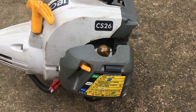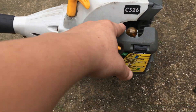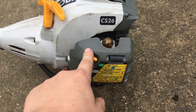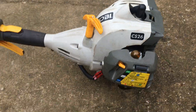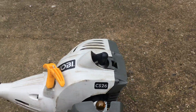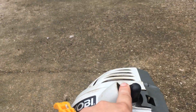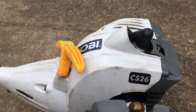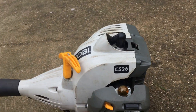Here's the problem. The carburetor — this is the carburetor right here — and that ain't the problem, because you can tell it's getting fuel, so it's not that. I cleaned it out and everything and it would not start. Spark arrestor — this one doesn't have one, so skip that. It has spark, it has fuel, put a new spark plug in, and it still won't start.